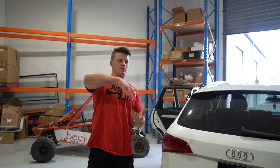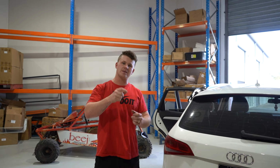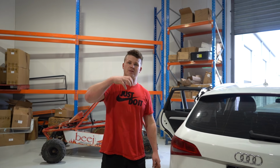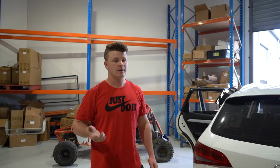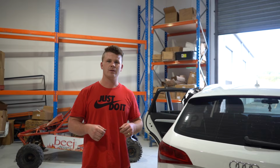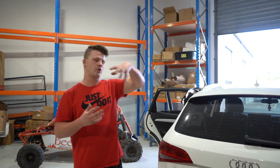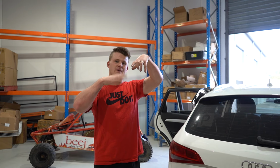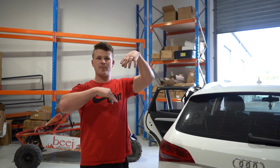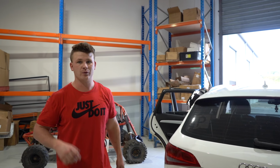Thank God the pump just pops up and pulls out like that. Remember that little orange piece is the part that has to come off before you attempt to pull it up, otherwise it won't come out. Oh, one last thing. When you go to put that seal on, make sure when you're at that point, you can have a quick look in and make sure the fuel level sender is popping up and down and floating on top of the fuel, and that way it gives you an accurate fuel level reading.